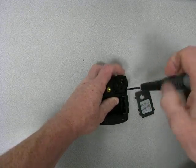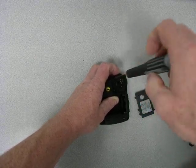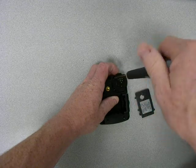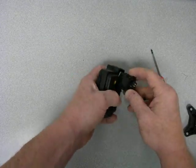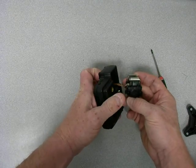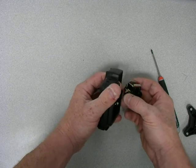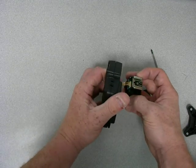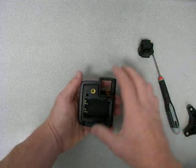When this hot shoe finally comes out, you'll see that it's attached by a flexible printed circuit board. We'll have to disconnect that, and in a later video I'll show you how to reconnect it. So here's how it's all connected. I typically trap the flexible printed circuit board with my finger, and you can either open the gates on the connector or just pull it off and it comes apart. Put the hot shoe aside.